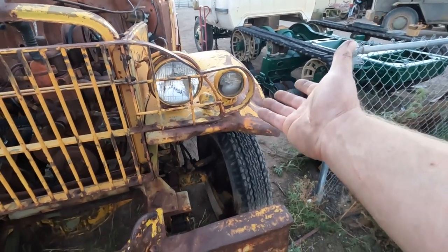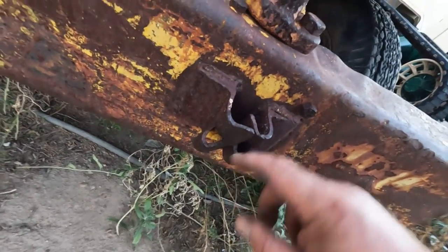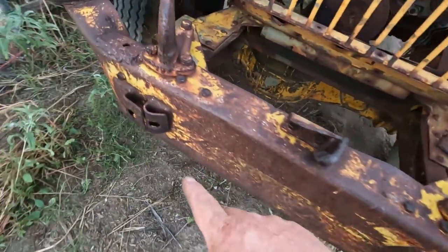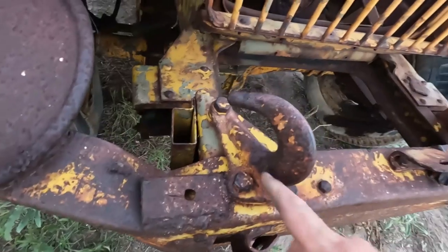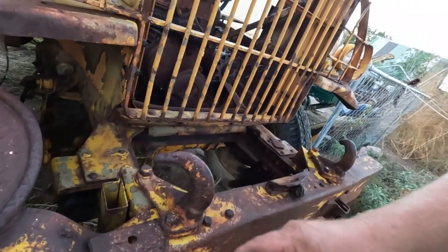Maybe it's a driving light. I see we have some tow bar mounts here. These used to have a tow bar on them. It appears they're completely folded flat. They're pretty flimsy for this size vehicle, so I don't think these are factory. The tow hooks, on the other hand, that's a 3-bolt mount, nice big cast piece. That looks like something the factory would do.